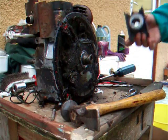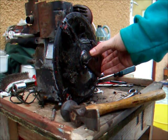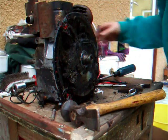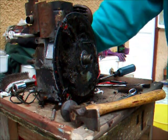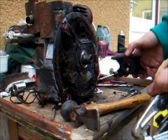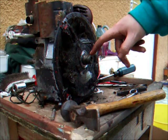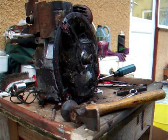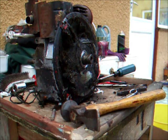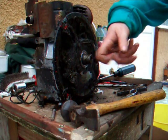We've just removed the actual coupling here for the blade - it's obviously on the end of the crankshaft here. That's pretty hard to get off. I used a small gear and pulley puller to pull that off. A little bit awkward because it's a square rectangle shape. But it's revealed a nice little stubby, really thick crankshaft - there's no way on earth that could be bent. So we shouldn't have a bent crankshaft from whatever it's hit, more likely a bent twisted blade than anything else. I'm quite happy to see that - it should mean that we don't have any problems with the crank.